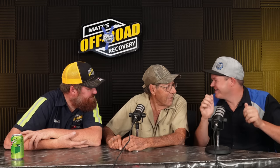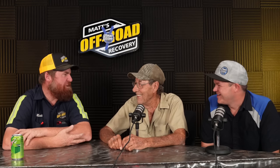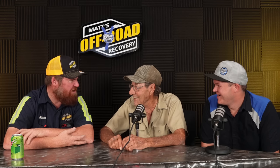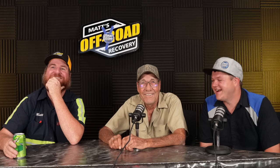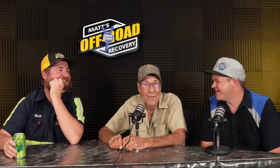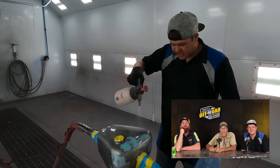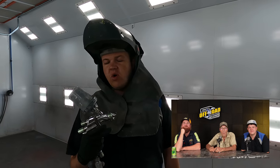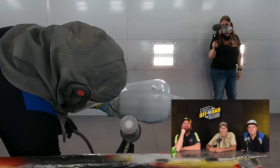I became a dairy farmer on this project because I milked it. Some people are pretty mad — they're like, 'you need to be nice to Ed and give him his stuff back, you're taking way too long.' Now I've retired from dairy farming. I've got the tank all masked up. We're going to use our solvent-based wax and grease remover. I've got the wash primer loaded up in my gun. Three coats later, it's got a guide coat.